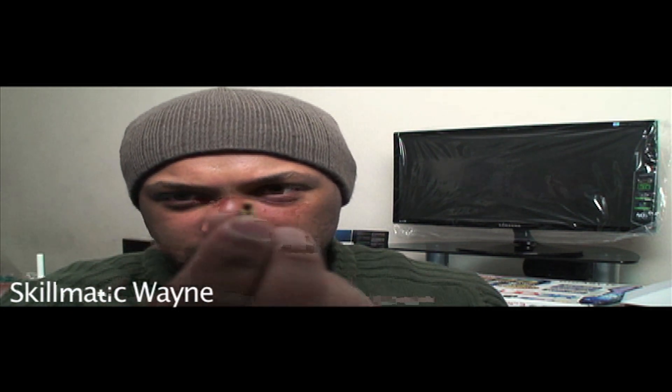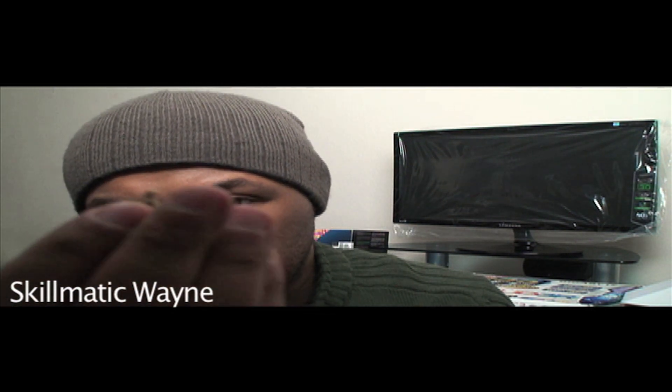The next thing that is very important when installing a motherboard into the chassis: you'll get these little gold-plated screws called risers — they look like this, gold plated with little hex heads. You have to install these onto your chassis. If you don't install them, your motherboard won't screw down properly, unless the case already has pre-mounted risers. Some cases have them, some don't. Check your motherboard first to see if you have any gold-plated risers, and make sure you screw them in the correct positions according to your motherboard — it fits like a puzzle.